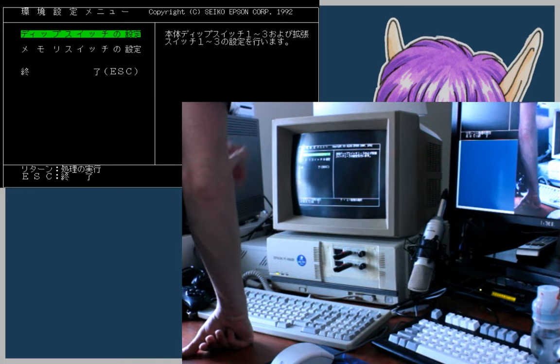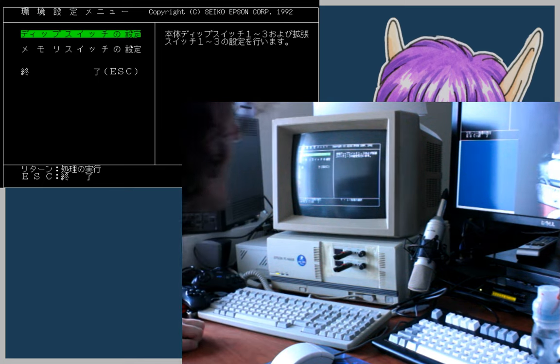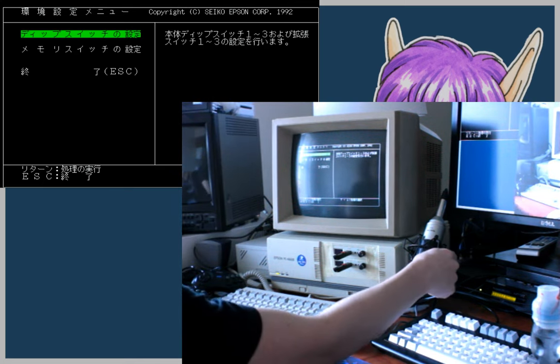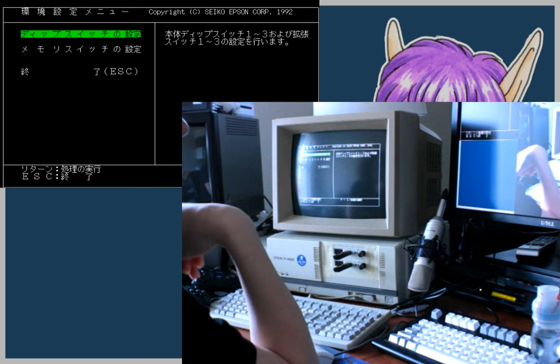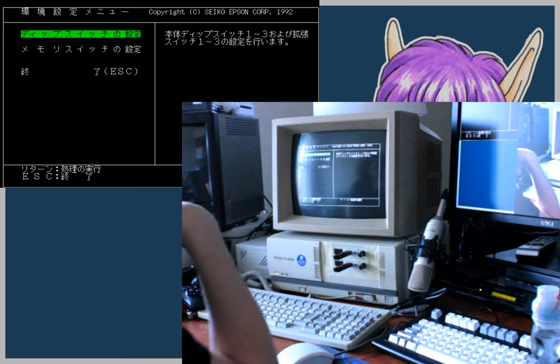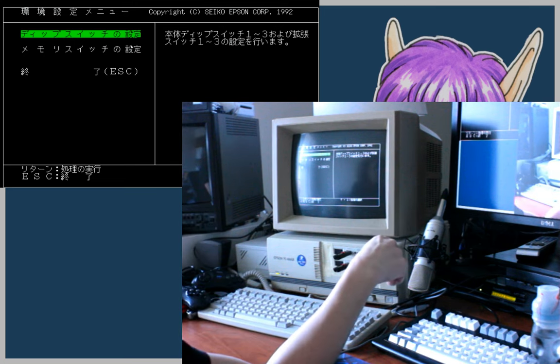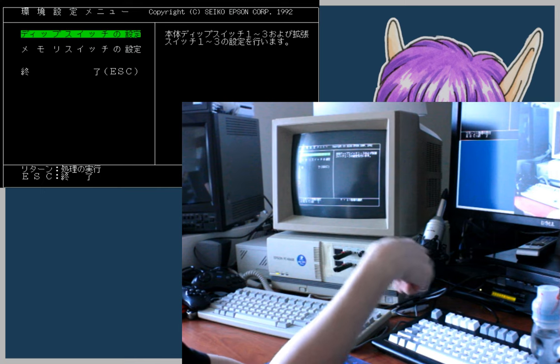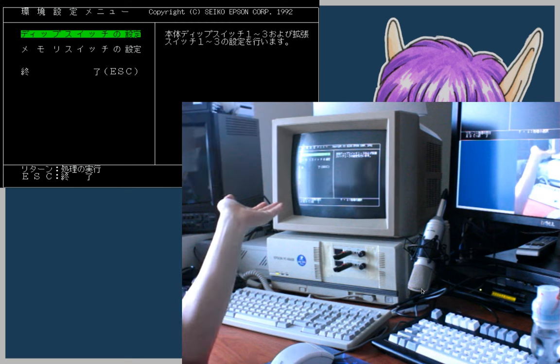I ended up giving the adapter I made in that video to a friend of mine, and then I made another for myself. Actually, I made two more. One of them is in the opposite direction, so I can run it into a VGA splitter and then into that. Well, you can't see it, but there's an OSSC, like a digital scaler, back there, and then feed that from the OSSC into a capture card to put it on the screen so you can see what I'm seeing.